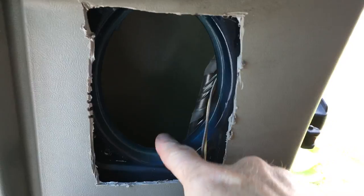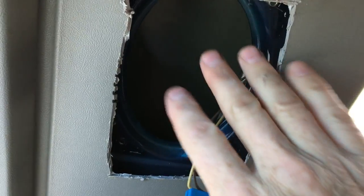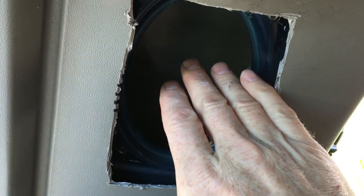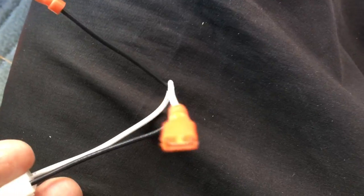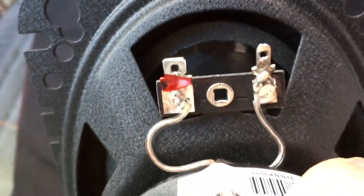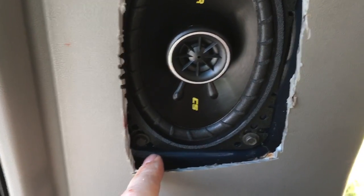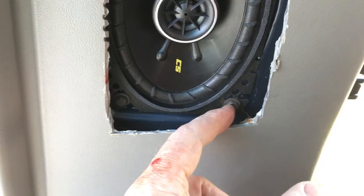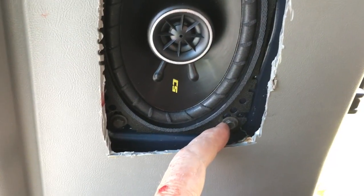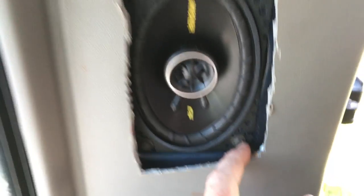There's a look at the hole — you can see it's specifically cut out for 4x6. While I'm in there, I'm going to stick a little bit of insulation against the back of it to try and improve the sound quality of the speaker, reducing some of the road noise from behind it. I bought a kit that comes with the appropriate adapter — it's got one wide and one skinny connector so you know the positive and the negative aren't going to get mixed up when you wire it in. When you tighten up the bolts, make sure you don't over-torque them, because you're screwing into sheet metal, which means if you turn too much you're going to strip out the threads.